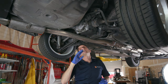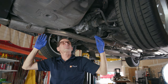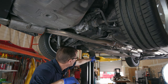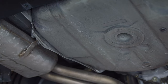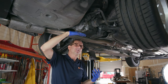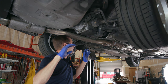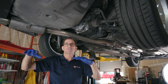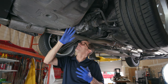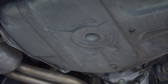And then when you get into these tire wells, almost all the cars, especially the German and Japanese cars, are sprayed or painted depending on the color. Like this car, inside the rocker panels and on this backside, we'll probably see it too. They have a combination of the color of the car, some metallic that's drifted in from the robot, and black. Some cars have black on areas where you'd see them standing looking at the car, so the factory puts black on them. We don't want to change any of that, and if you're not careful, your pattern and your method of cleaning will remove some of it or create a real blotchy look.